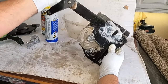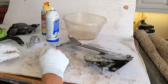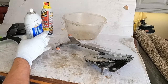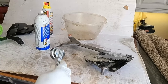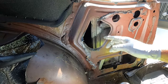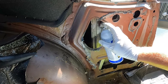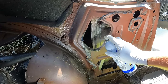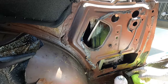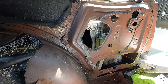I'm probably overdoing it a little with the white lithium grease, but I really just want to make sure this thing is smooth up and down with no binding. I don't want to deal with the window getting stuck down again. Let's take this over to the car, clean out those other channels, get them greased up, and then put this back in. One drawback to white lithium grease is it gets really sticky — so it's kind of a maintenance thing. We need to make sure these tracks are nice and clean and lubed up, including the track in the window and the one on the right.